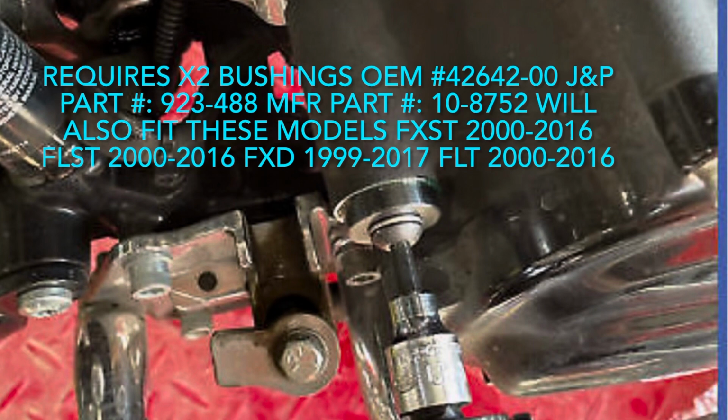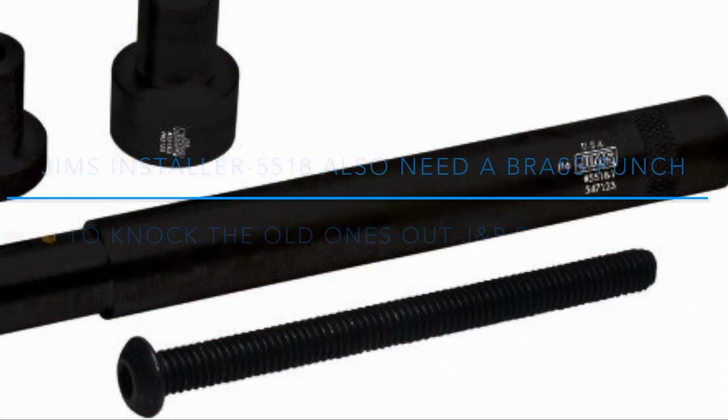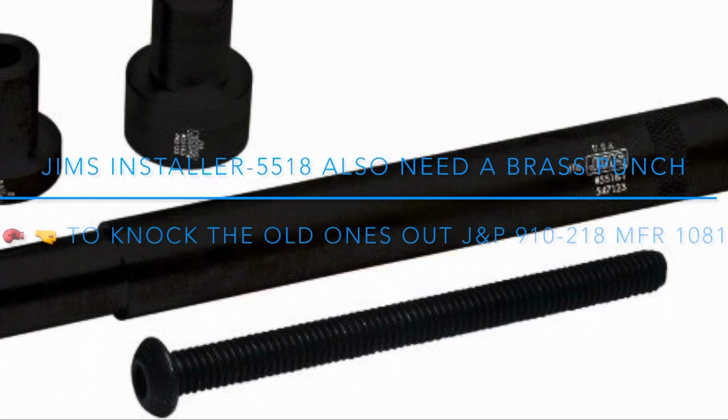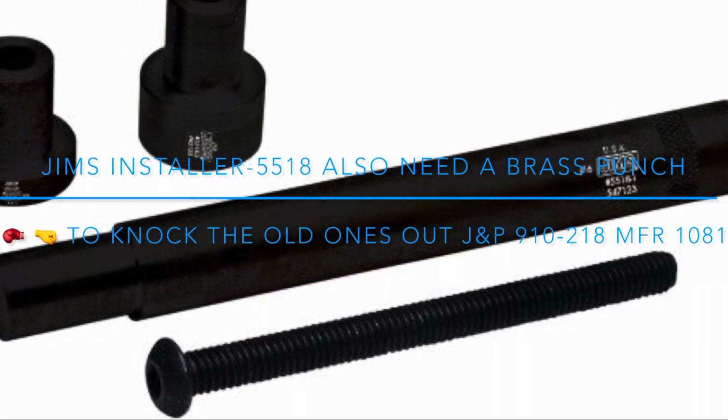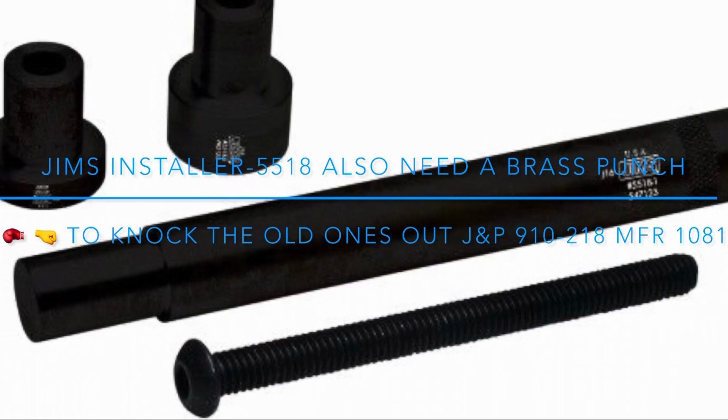However, the most overlooked thing I see is the shifter shaft bushings for all 2000 to 2016 twin cams. Removing and installing the two new ones will make it feel like new in the front. This can be removed without taking off the inner primary, but the outer will still require removal with Jim's part number 5518.